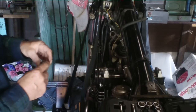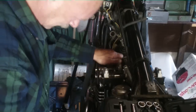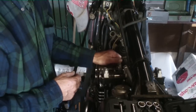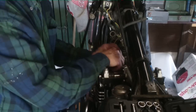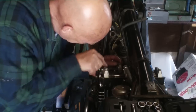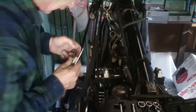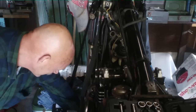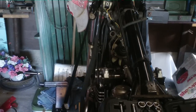And when you put these down, you always want to set them so you put them right back on the same place, because your bearings tend to wear after a while, and it's best to always put them back so that you're not changing bearings and stuff. Is always to put them back exactly where they went. If not, it's going to create problems maybe down the road. So always set your caps so you know where they went on, which direction and where at and all that stuff.